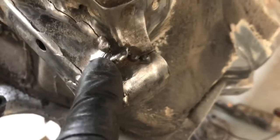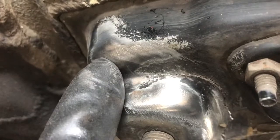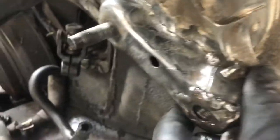I've just put some tack welds on here just to hold it in place. So the crack started there and it ran all the way up there, all the way up here, all the way around here, and here, around here. It's hard to see, so I'm going to paint it off — all the way around here, starting to come up here to the bulkhead. And the reason that happened is because there was a crack at the beginning which someone had tried to have a go at, which has cracked all the way up the front as well, all the way up and around there.